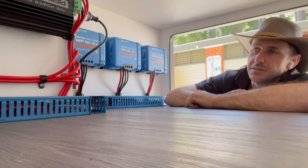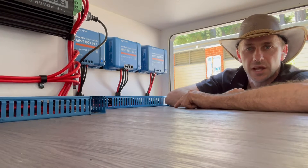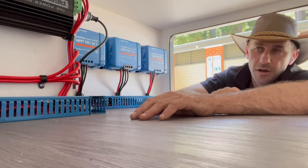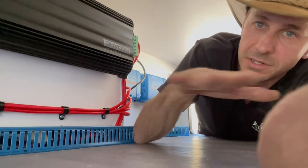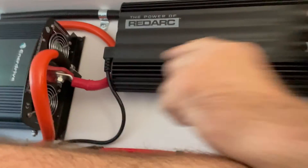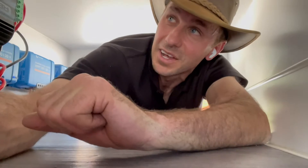Here we are inside the London Crusader. The Redarc factory system is installed here. We've put the remote in the old original spot, because this previously had an Enerdrive 2000-watt inverter with an old switch. We've replaced that with the remote and tidied it up. These guys are free camping right now — unplugged from mains. We're at 59% state of charge at the moment. We're actually pushing in 10 amps of solar — getting about 15 amps in the shade with the lights on and compressor fridge running. That's only possible when you've got 1,400 watts on the roof.